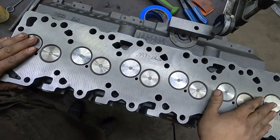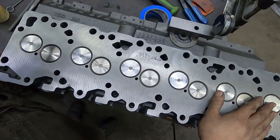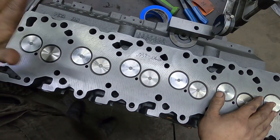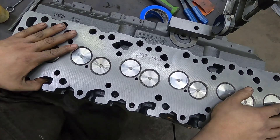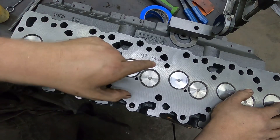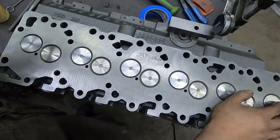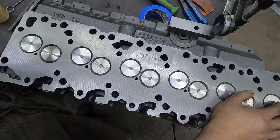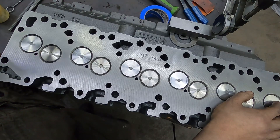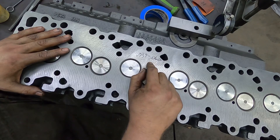If you are having the cylinder head rebuilt and you want to run an aggressive camshaft — like a stage three, stage four, or even a stage five where you're basically building a race engine — in something like a Colt or Hamilton, like a 188 or 220, which technically is a drop-in cam, or any of the big guys, I personally would want your valve recessions in the 60 thou range, if not a little lower. Because of the lift on the camshaft and the RPM you want to spin — if you want to spin 5,000 RPM with a big camshaft, there's a reason for that big camshaft — you want to keep those valves away from the pistons. This is a standard spec for running a stock engine at stock horsepower at stock RPM.